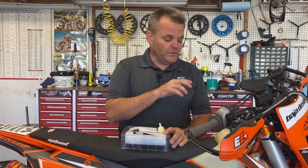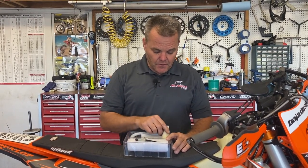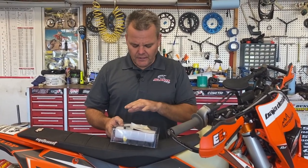I'll actually start this thing up and you can actually see this filter. They crack, and I'm sure many people who are aware of this have seen them. They crack and you can actually see it pouring out. Since we're going to replace it, we're going to go ahead and do the pump and everything at the same time. We have this complete All Balls kit at a really good price to rebuild the entire thing. Sometimes the pump does fail, sometimes it's a filter — this kit has everything all in one. A lot of times you'll see bubbles; in this case we see it actually squirting out of the filter, especially as you rev it up.